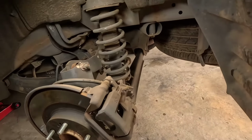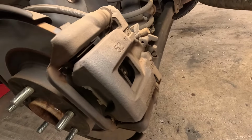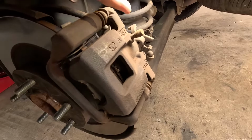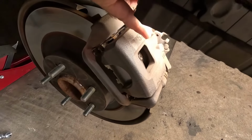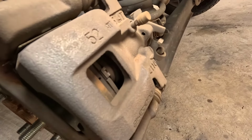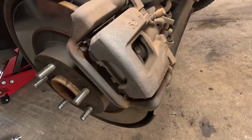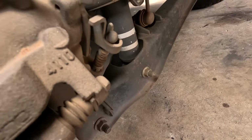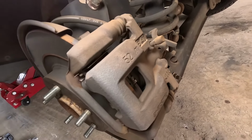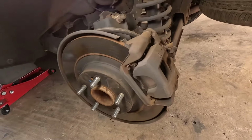Moving on to these rear brakes. All right, so these are easy enough as well. It seems that the handbrake is in the caliper, so I'm guessing we've got a piston that'll need screwing in rather than pushing in, like the other one. But same principle, we're going to undo them bottom bolts there. We'll probably just do that one, and then flip the caliper up, and then we'll have a look from there.